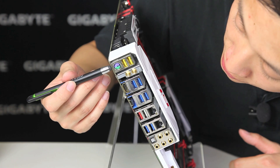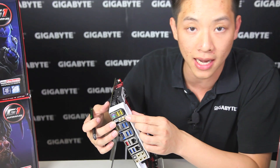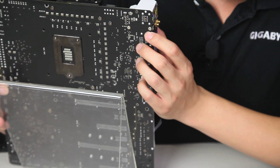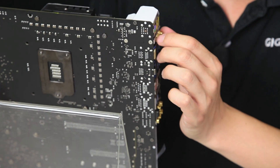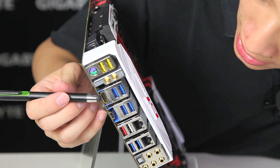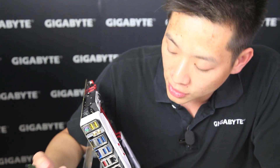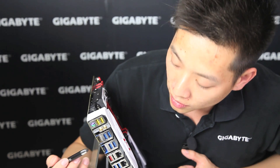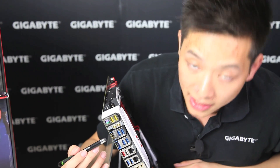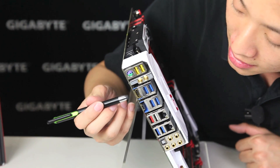You have your traditional PS2, also Wi-Fi connectors right here — we include a little clip that allows you to lock in your cables for your antennas. There's a little screw hole right here to let you unscrew and reach that M.2 wireless module inside. Right here we have an HDMI — and this HDMI is actually HDMI 2.0. This means it allows you to actually display 4K content at 60 frames per second, so if you guys want to do a movie night or anything like that, this board has that ability.